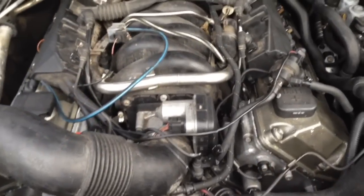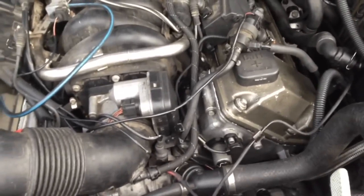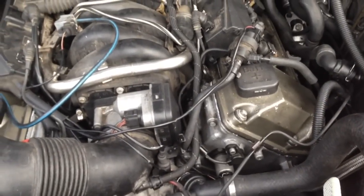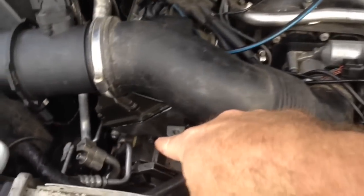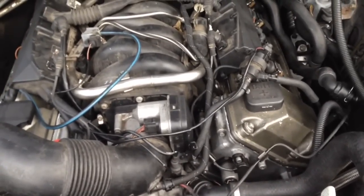There's one other thing I think could be hindering me too. On the exhaust side, the last couple times I did this I loosened that up on the cam bolt, but it seemed like maybe it wasn't loose enough — like when I tightened the tensioner down it wasn't ratcheting the whole thing to take the slack out. I think that was also another problem.